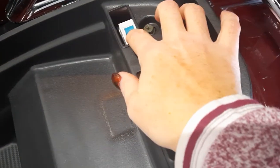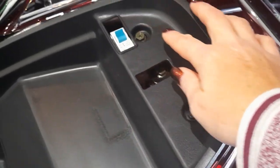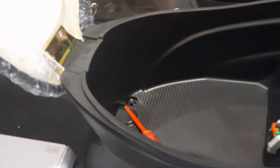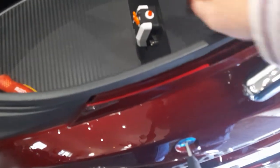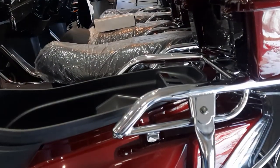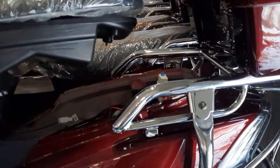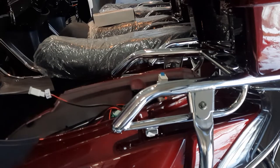First thing I'm going to do is turn off the breaker. This cuts off the power to the whole bike, including your alarm systems — you no longer can alarm your bike. I've already loosened all four screws. This is going to lift up like this. It's going to be a little heavier on the bottom, but be careful because we've got our light and USB charger still connected. With two hands, we can close that and carefully put this to the side.